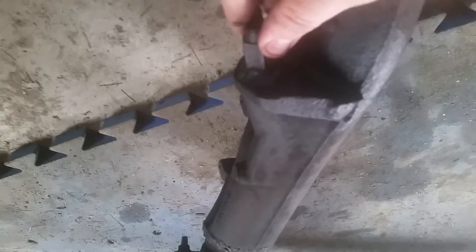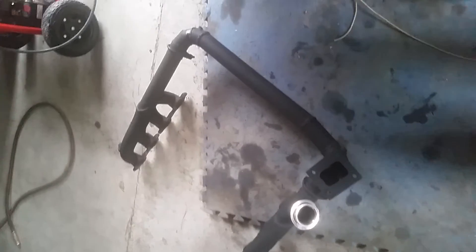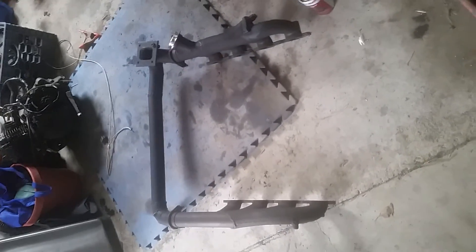I welded a lug nut in for my EGR thing, and it fit perfectly — the taper makes it ideal to weld in. The only next things I've got to do are make a gasket, put the tank back in, run the lines, install my starter, and wire up the micro squirt. Then it should be good for a test firing to see if this $400 5.3 is good or crap. Thanks for watching.